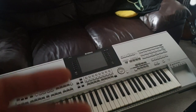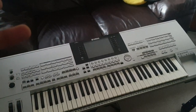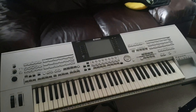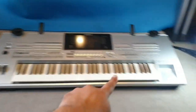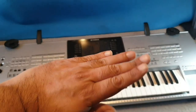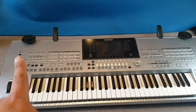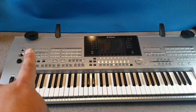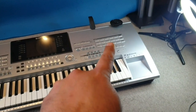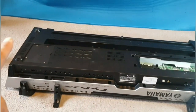I don't have a desk or a table to do this on — if you do, then that's good. I'm going to put the keyboard on the floor and let's see how it goes. As you can see I've got a mat against my TV stand because I need to stand the keyboard to disconnect some connections — the power button and also a couple of ribbon cables. The keyboard is upside down because we have to remove all the screws.